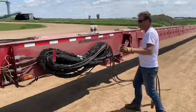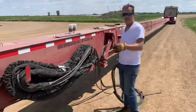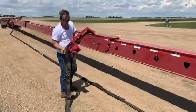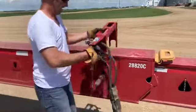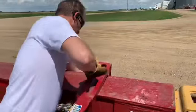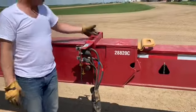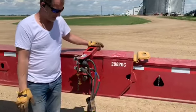The airline hoses are not going to be long enough from point A to point B, so we're going to stretch these out as much as we can and then put the extension on. The extension is in my truck right now — it's basically to extend your lines on the front gooseneck, that's it. These little cutouts here will fit nicely on both sides. A lot of guys are putting a strap — not a bungee — just a small little strap to hold it down.